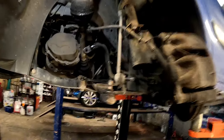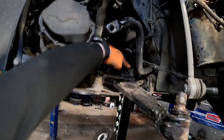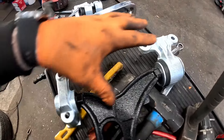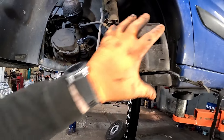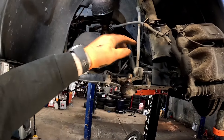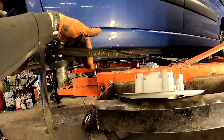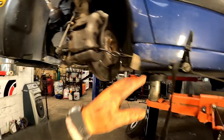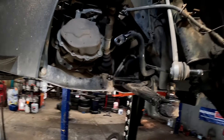For those of you who don't know, these bottom arms are connected to the anti-roll bar at the back with brackets, and that is the shape of the bottom arm. Now imagine trying to get that bottom arm in and out with all this hanging in your way. So I've disconnected the driveshaft and anti-roll bar link and pulled it around the ramp with a ratchet strap - just look how much room we've got now. It takes a couple of minutes to get it to that position.